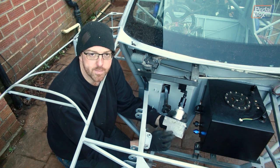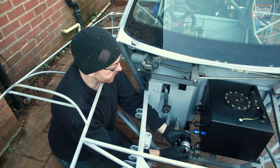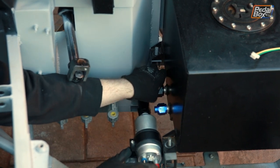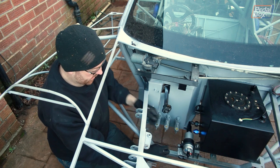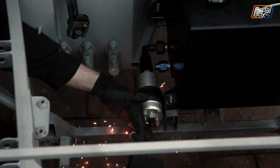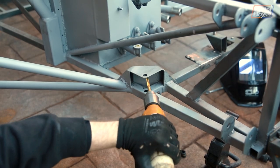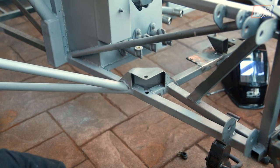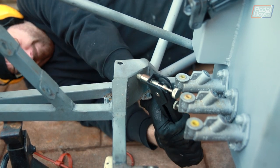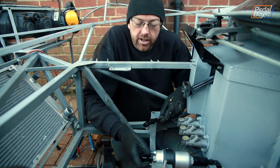The tank's back in the car and this is our fuel pump assembly. We've made this little platform out of some 1mm plate and just bent the edges over for a little bit more stiffness. This just sits underneath the support here and we can attach the pump on with its hard line. The platform's all welded in and we've attached the pump back onto it, so we can fit our AN to flexi fitting onto the outlet from the pump side.